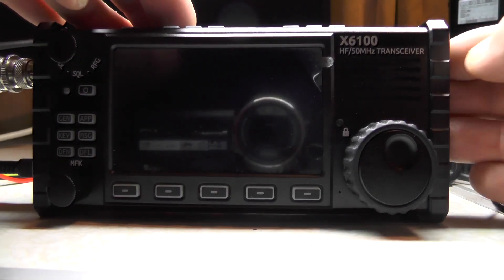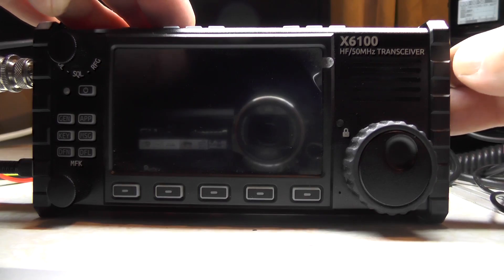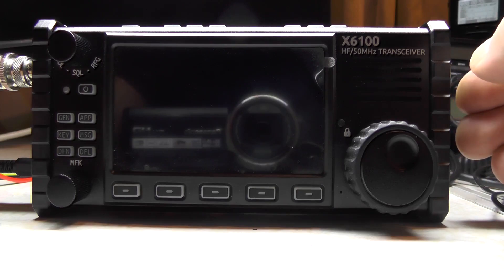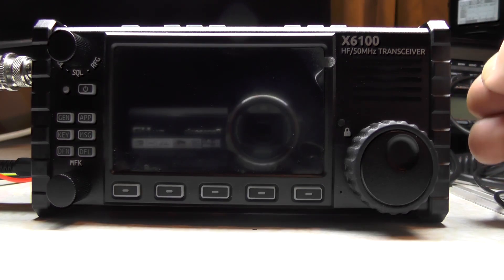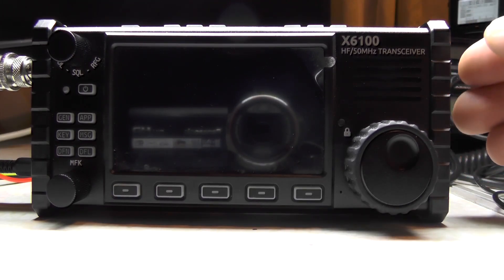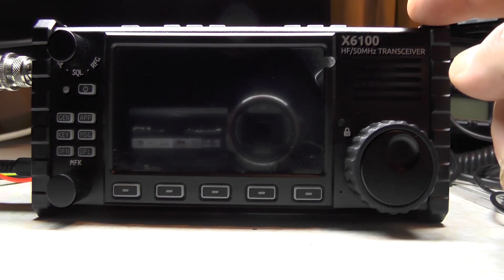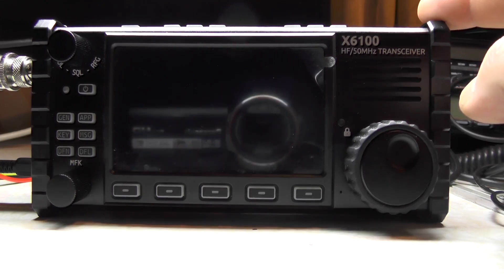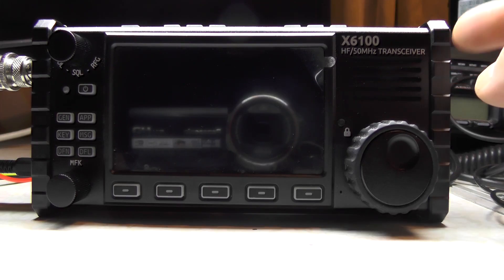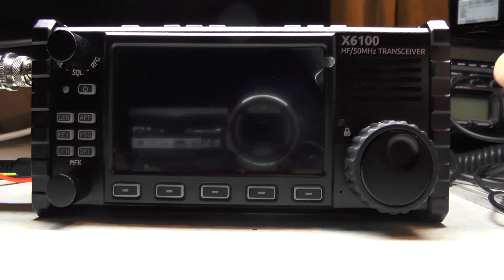A good thing about this firmware is it runs off the SD card, and once you finish with it, power down the radio, remove the micro SD card, and you're good to go with the default software. If you haven't seen how to do it, watch my black screen of death video — I'll show you how to flash a memory card. Just install the R1CBU firmware to the memory card instead of the X61 firmware, and you'll be good to go. I'll link in the description box where I got the firmware from, and in the end card I'll also link the black screen of death video.